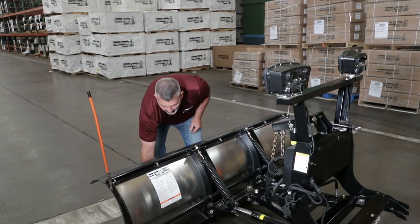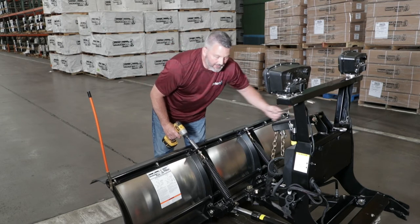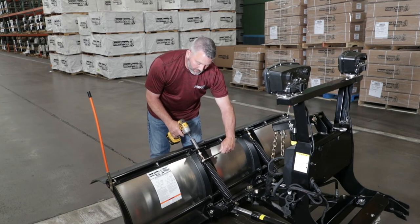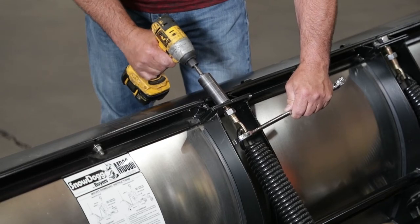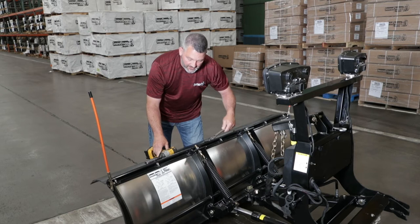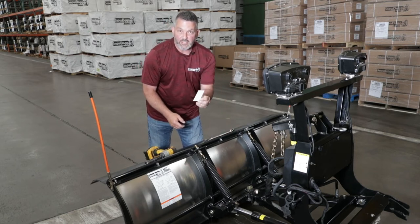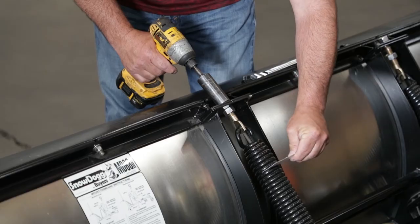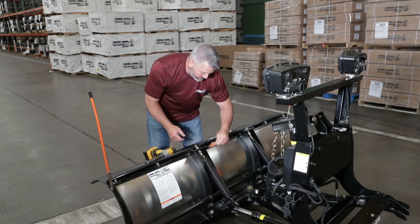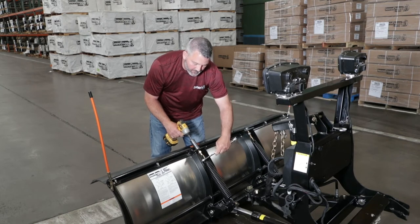The next step is take your impact gun and put it on the locking nut. What I do is I take the 15/16 wrench to make sure my spring doesn't twist as I'm tightening it. I'm going to tighten it a little bit and keep tightening until I see the coil separate a little bit — that's where the business card comes in, because you want to make sure you open the spring enough that the business card will go in. I don't want the spring to twist.